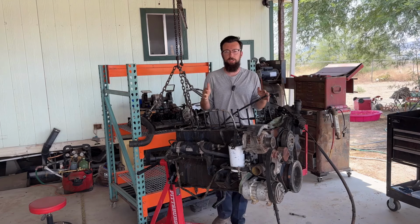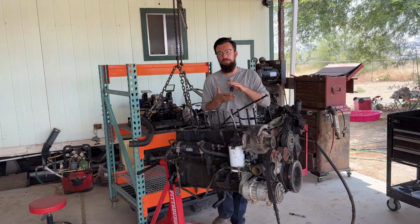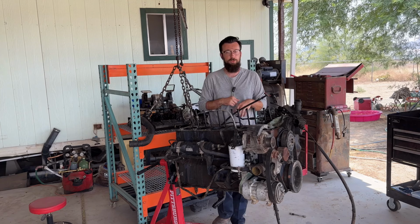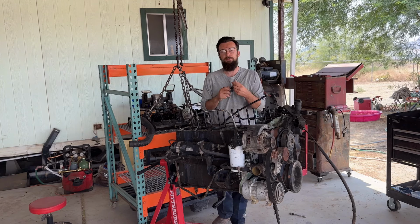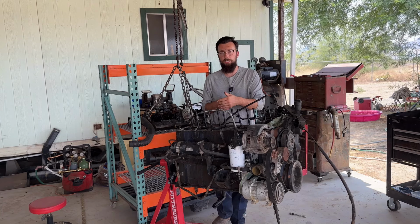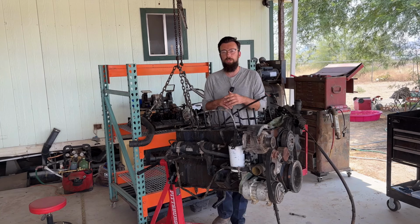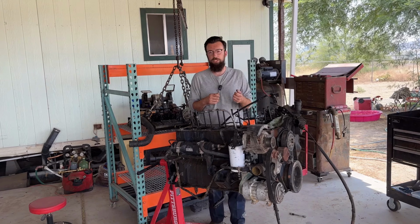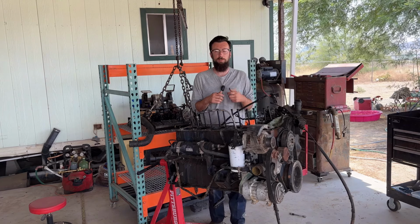And I want to fix the overdrive. Well, my truck came with a 727, which is a 3-speed, and these trucks came with an overdrive. That was the whole reason for the switch. But I have the overdrive hooked up to a toggle switch. So the first 3 gears are hydraulically controlled. There's no electronics. But 4th gear is controlled by an electric switch. I have it hooked up to like a makeshift thing, a toggle switch that's not permanent.